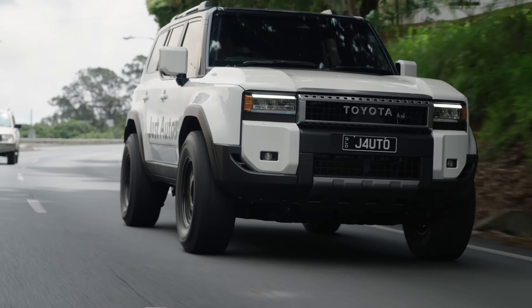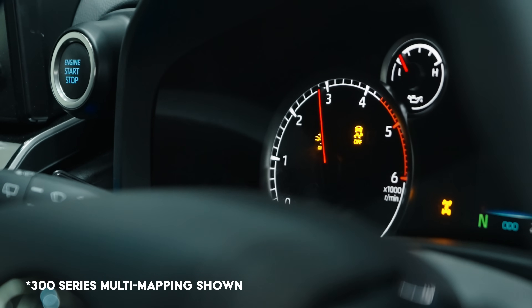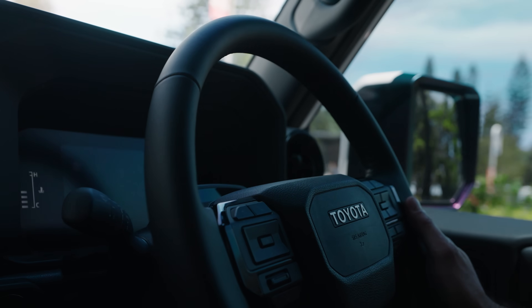The power part we did very quickly — that was the easy part. As far as the multi-mapping goes, we've got the same multi-mapping set as with all of our cars, so you still have things like idle up, immobiliser, launch control, and three different maps all switched from the cruise control on your steering wheel — all still much the same as other models.